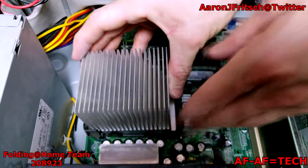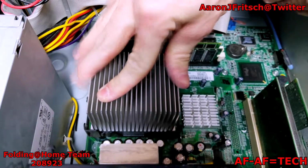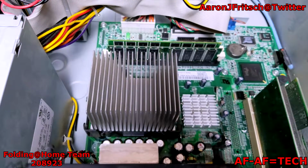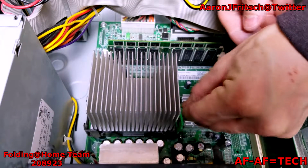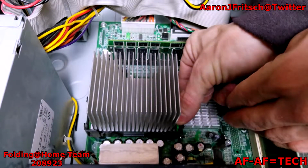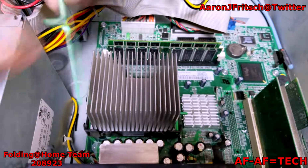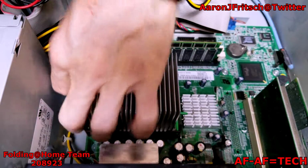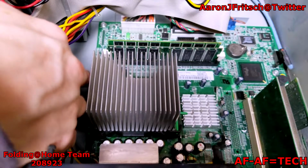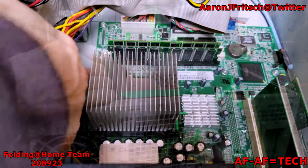Then we'll find out what we're looking at with this CPU. Alright, there we go. Seeing that it's passively cooled practically, with this weird tunnel airflow system they have, I'm willing to bet that that dab of thermal compound, along with just having it clean, is more than enough to keep this thing cool. Either that or it's going to downclock considerably.